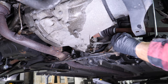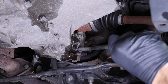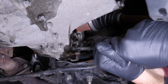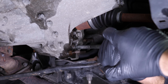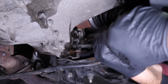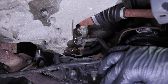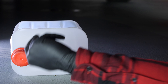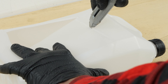You can then remove the plastic cover, if any, to access the gearbox drain nut. Be careful not to confuse the gearbox drain nut with the engine oil drain nut — the gearbox drain nut is located under the driveshaft, where it fits into the gearbox. In some cases, it may be advisable to unscrew the strut bar to make it easier to unscrew and screw the drain nut back in. Using an oil service spanner, unblock the drain nut and finish unscrewing it by hand. Be careful on the last few turns of the screw, as the oil may suddenly squirt out. Anticipate this by placing a container underneath to collect the oil. You can learn how to make one by watching our video on how to make a collector for liquids.